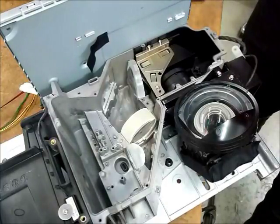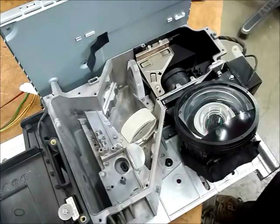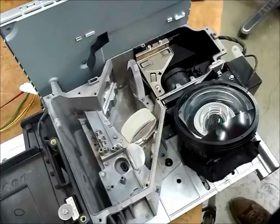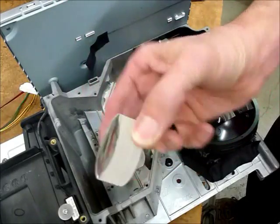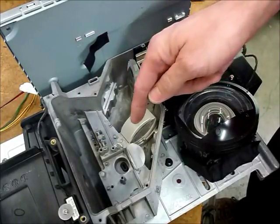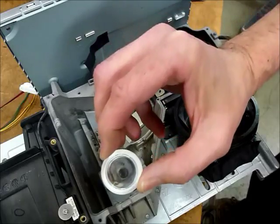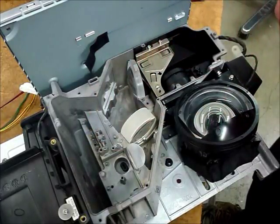Pay particular attention to the way the lenses are oriented in the engine. If you notice they are hazy you may want to clean them. Whatever you do, do not loosen these screws — there are two on the top and one on the bottom of the lens. Don't try to move that lens; it is really hard to realign if you do. The lenses just sit in here — nothing actually holds them down. You can see these are in very clear shape. Pay attention to the way they go back in: there's a gap on the lens — the thin part goes towards the DLP chip, thick part towards the lamp. This one only goes in one direction. If they have haze, clean them gently using nothing but water and a very soft cloth.